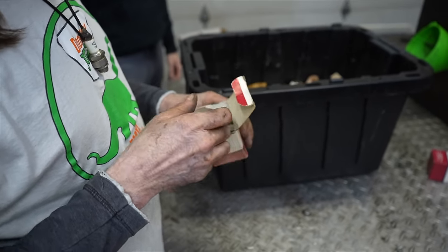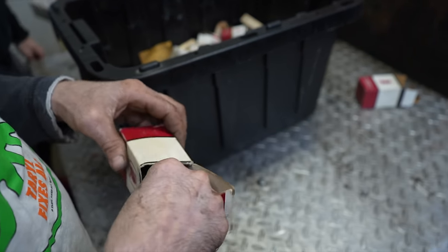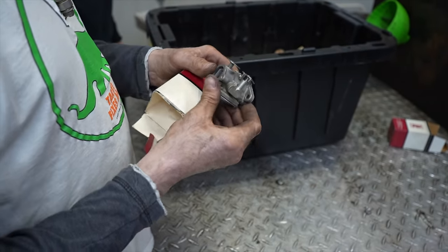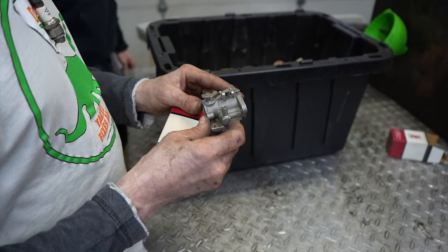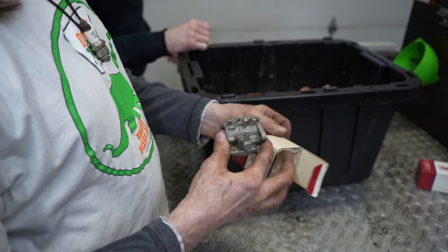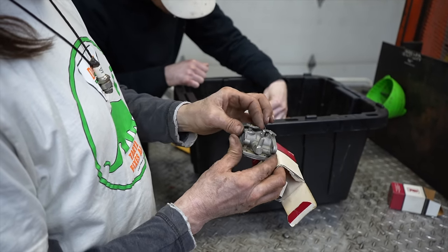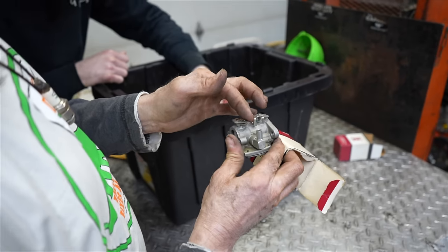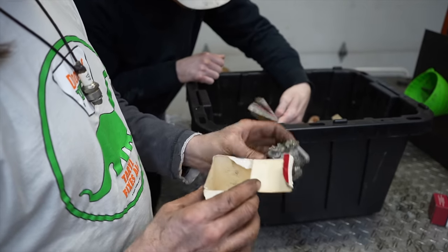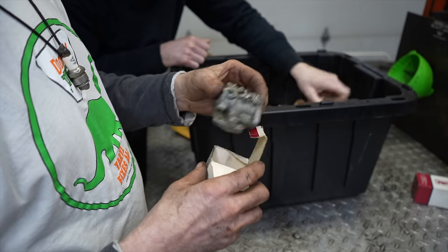Another carburetor — part 631451 — a diaphragm carburetor. With the fuel inlet facing up, this was probably on a four-stroke like a 3.5 horse Tecumseh, where the fuel tank sat right on top of the carburetor with a short fuel line. It has a manual choke and a throttle, so this was probably on an old Ariens snowblower with a 3 to 3.5 horse engine — not a two-cycle because of that manual choke.